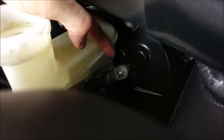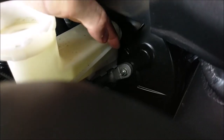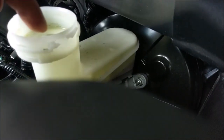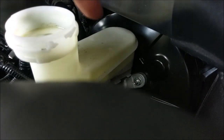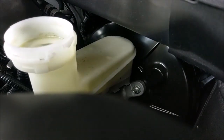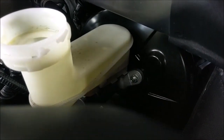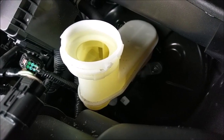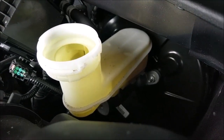Sometimes you'll run into a little bit you can't get in certain designs of these tanks in the back bottom. So what you do is gently fill it up in the front so you don't mix things around too much, and then when you start flushing out it'll suck from the bottom. Old fluid goes out the caliper and you keep filling up the reservoir. It's now full of all new fluid except for that bottom portion.